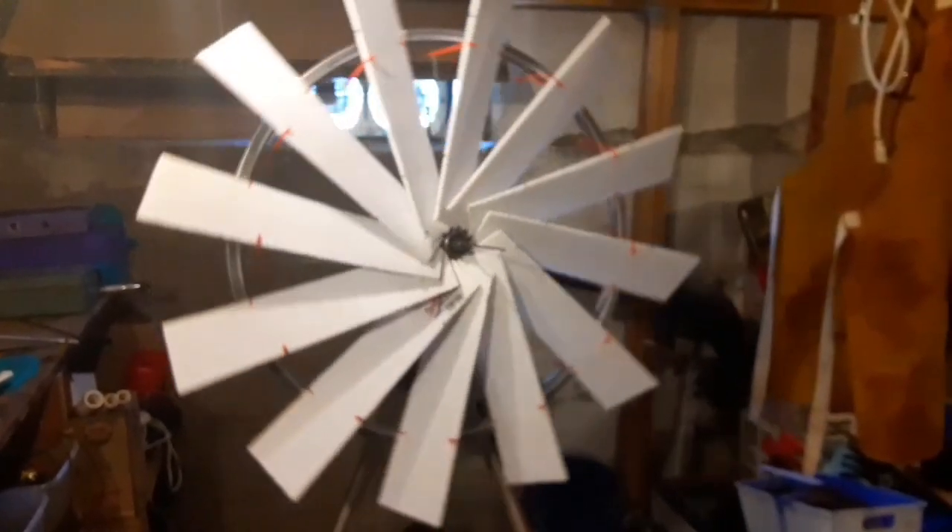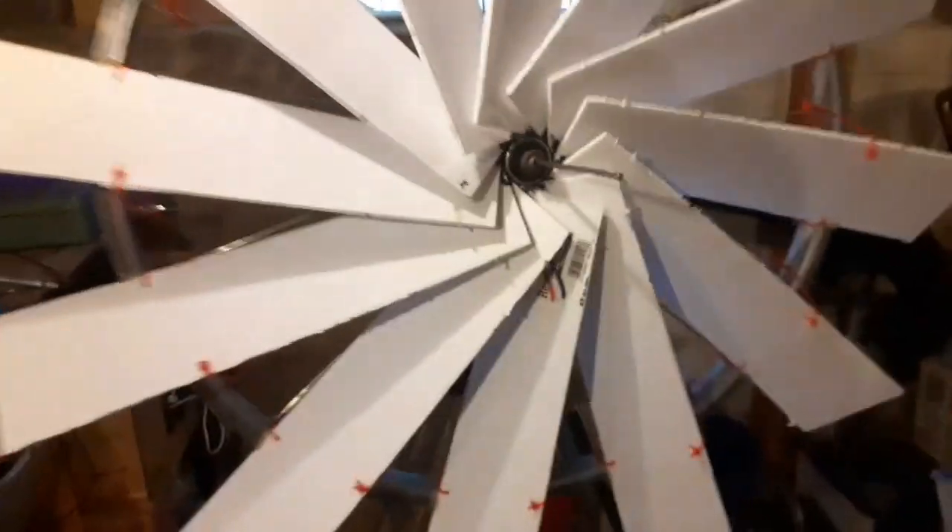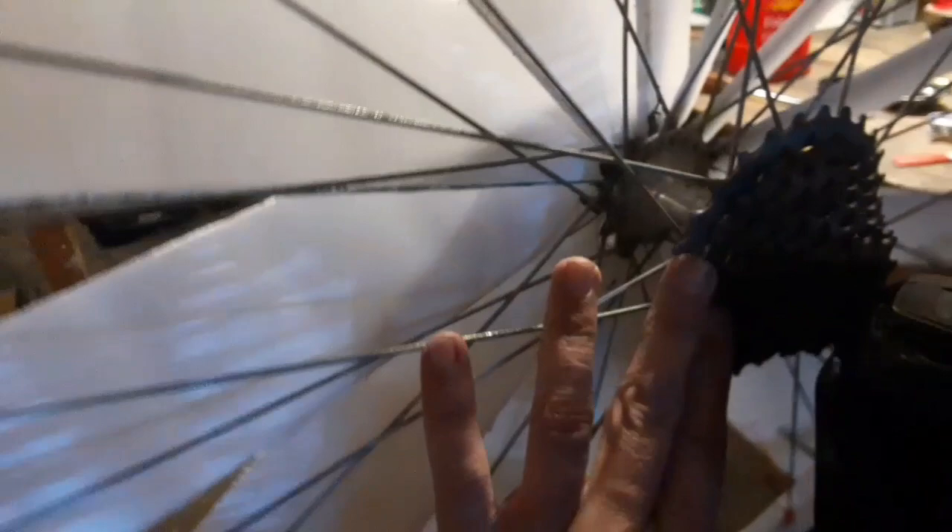Now the way I plan on connecting the motor to this, I have two options: I can use the channel in the wheel there, or I can use this sprocket here. But the sprocket I'm actually going to use as a brake, so it'll only spin one direction and lock up if it tries to go the other direction. I can get a better gear ratio to the motor if I just use the channel of the rim where the tube usually goes.